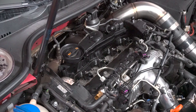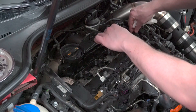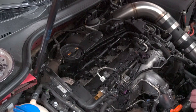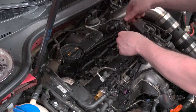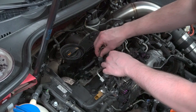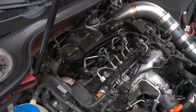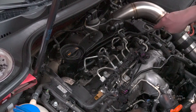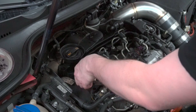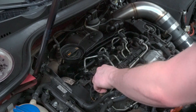We're going to start reattaching all the lines and everything. I've gone gloveless now because everything's pretty clean since it's all fairly new. All the return lines are on — start putting the fuel lines back on. The torque spec for the fuel lines is 18 to 20 foot-pounds. I'm going to guesstimate on that. Get everything de-zip-strapped. That's all the mechanical stuff done — it's all installed.